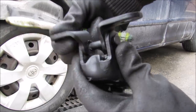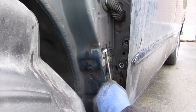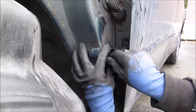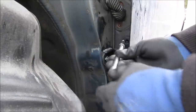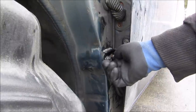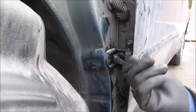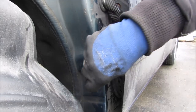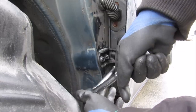This here is the replacement door hinge — it's a lot tighter than the existing one with very little axial play. I'm cleaning off the old sealant and then installing the new hinge. I'll put in the first bolt, catch the bottom bolt, then the top hinge bolt, and then catch the inner bolt. I have to remove one bolt first because the wrench can't fit otherwise. Then I'll run both down and give the inner one a final tighten — that one has to be tightened somewhat awkwardly with a wrench. Tighten everything down nice and snug.